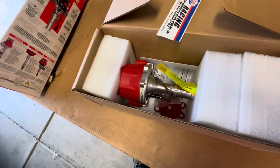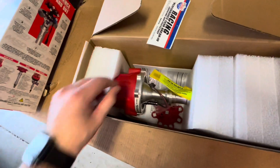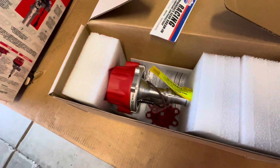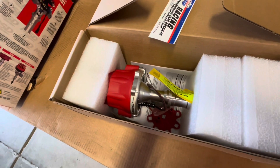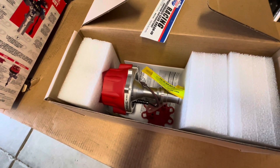Other than that, it's essentially identical to the distributor I have, minus the vacuum advance. This also does not have a vacuum advance, and you do not want a vacuum advance on your MSD Atomic if you're going to use it to control the timing. There are a few exceptions, and the MSD Atomic directions will tell you that.